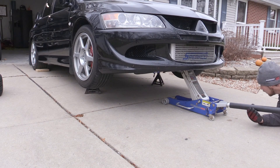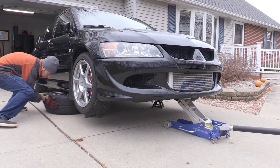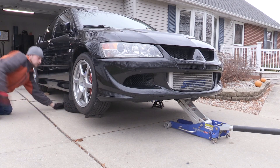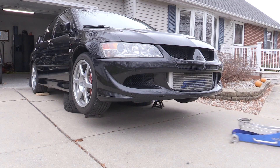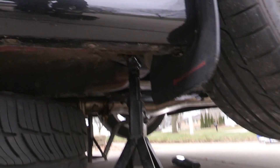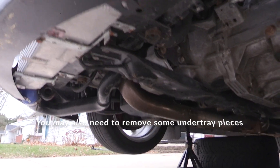Make sure you're on a fairly level surface. Safety first — a floor jack is meant just to raise your car, it's not meant to hold it while you work. Never go underneath your car when it's just held up by a jack — that's why you use jack stands. I also slide wheels underneath the car as an extra precaution so that if the car falls off the jack stands it wouldn't crush you. Make sure to place your jack stands on a solid part of the frame.